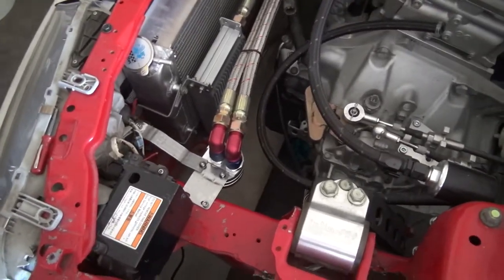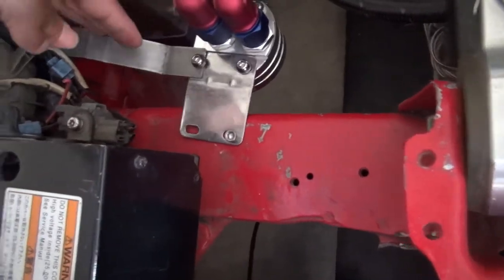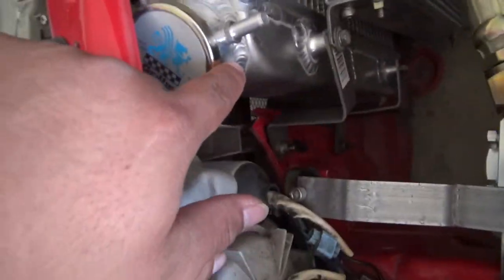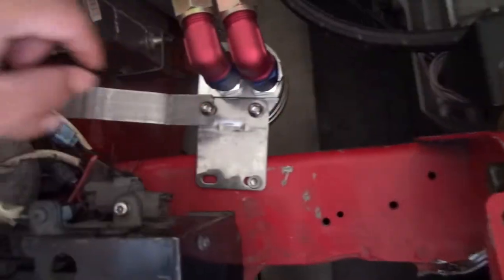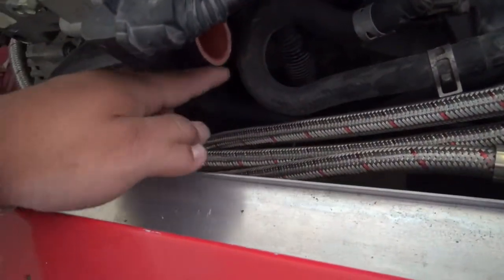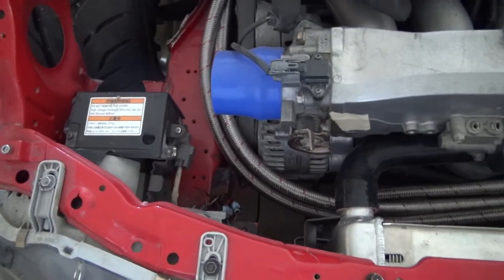Someone stole my oil filter. Anyway, I've built brackets for the radiator so it's permanently attached. I can still access the cap, but the cap is semi-tucked. The cooling bottle is going to end up right down here — I need to get a hole for it. The lines wrap like we had them before, and I've had to buy a hose adapter, going from one and a quarter down to one inch. I still have more joints coming in on order for the hoses.